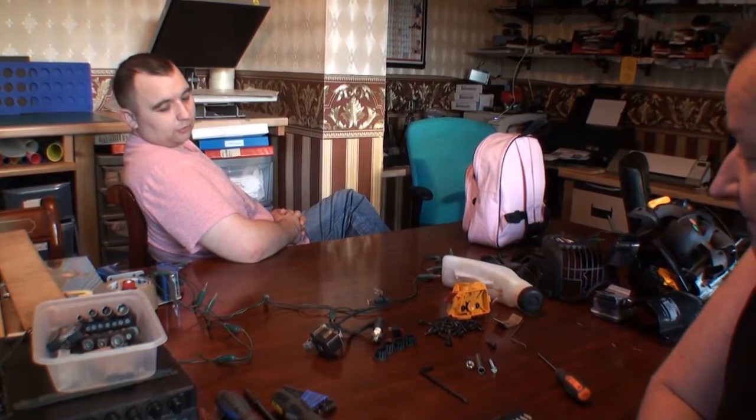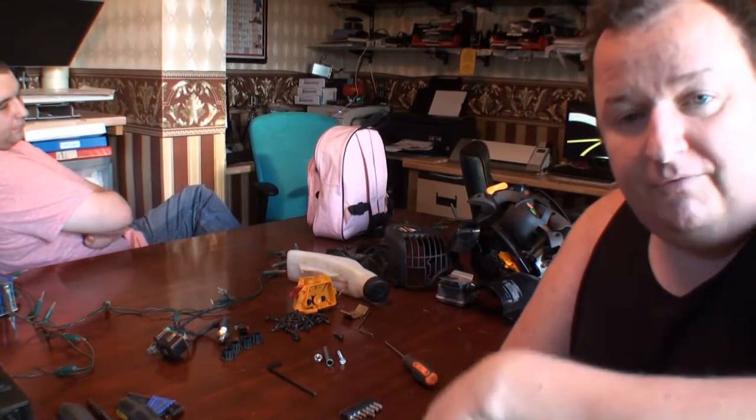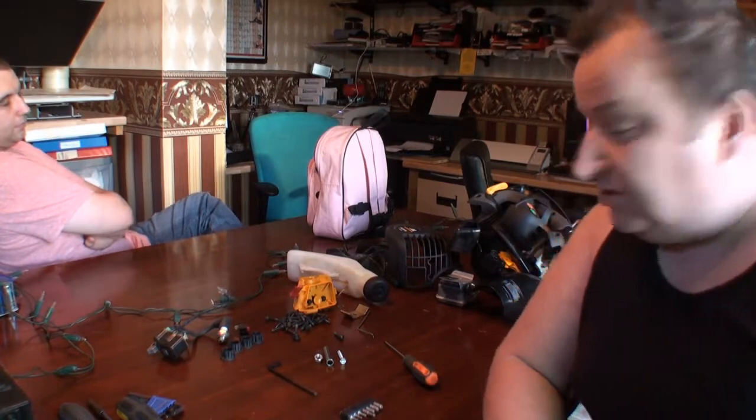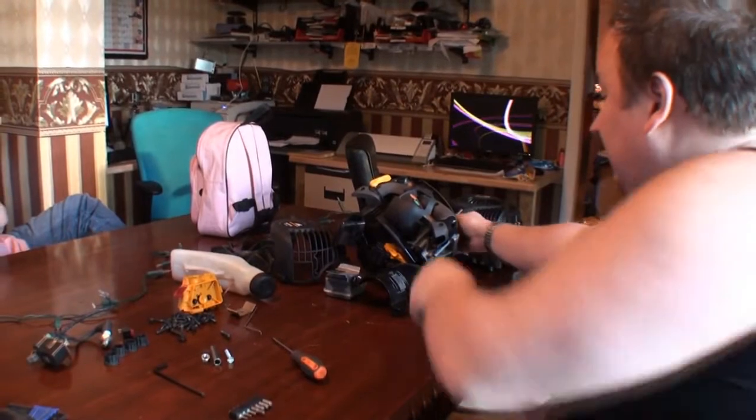Anyway, Bert, you had a look, didn't you? I had a quick look. What did you find? It gave me a sore arm — yeah, pulling it over. So he had the same thing; he took it apart as much as what I did. Checked spark plug, fuel and compression — put your thumb over the top of the spark plug and we had compression. Anyway, this time I've decided to strip it completely down. You might see it sitting in a pile over here now.